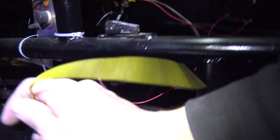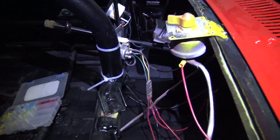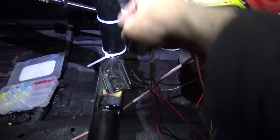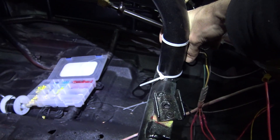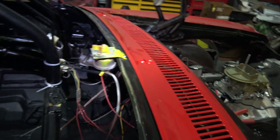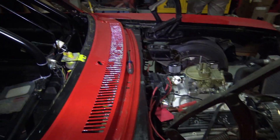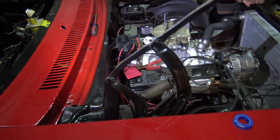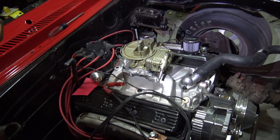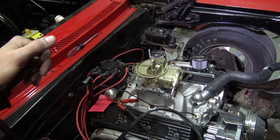Really easy to wire, just a few little basic things. This little ignition switch basically just gives power to the coil. This kind of has power for the most part, so you can crank it without having power to the coil. Should start if we sprayed some starting fluid in it. This is basically a new motor, so I don't know if we want to do that or pour a little bit of fuel in the carb just to see if it'll go.